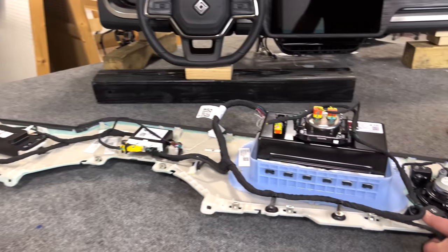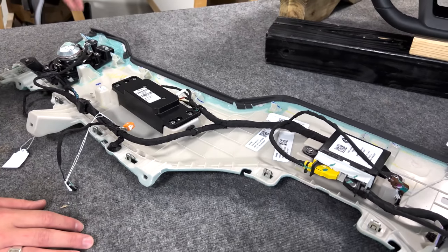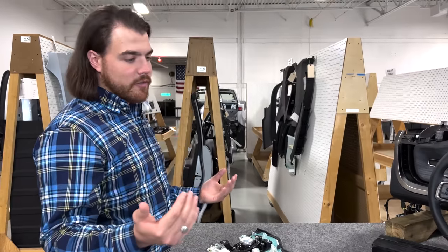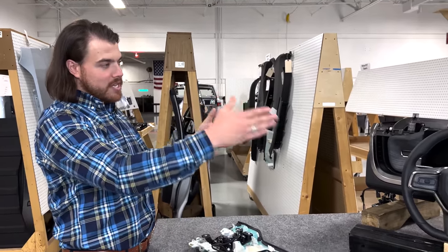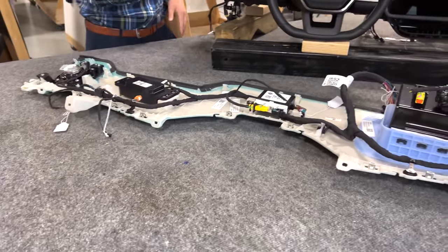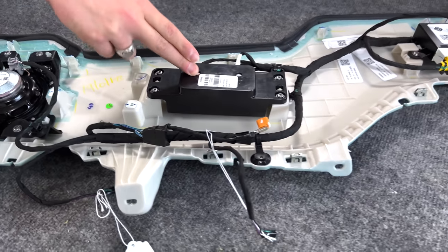If you're familiar with dimensioning, that design is fully constrained at multiple points and you have to fight all of that stretch to get it to lay perfectly. With the Rivian design you have some fixed points in the middle and slack on the ends that allow for more automation. It's also worth talking about this top cover - it's not typical in the way it's executed. Oftentimes you'd have a top cover that goes over a skeletal sub-layer with a decorative cover on top, but doing that on the bottom of your A-surface top cover means you don't have the opportunity to integrate and mount different features. Rivian, by virtue of their IP construction, has left real estate to under-surface mount several different elements here.